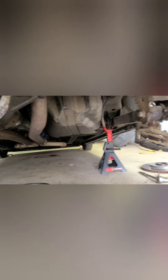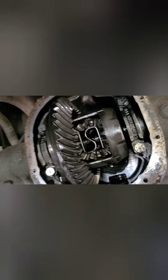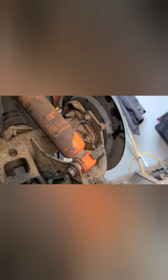To do this, you'll take your panhard bar and sway bar and move them out of the way because they're in the way of the cover. You'll take off your brake caliper brackets - just take them right off where it mounts, not the actual calipers themselves. Those are 15 mil for the sway bar bushings, and 18 mil for the panhard bar. I just took one side to drop it down, but the sway bar you've got to take both sides.